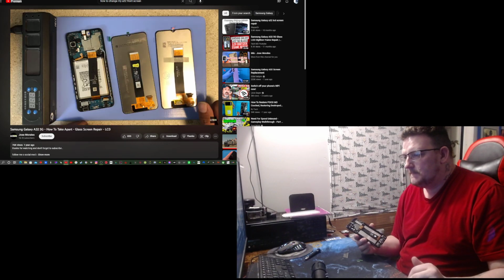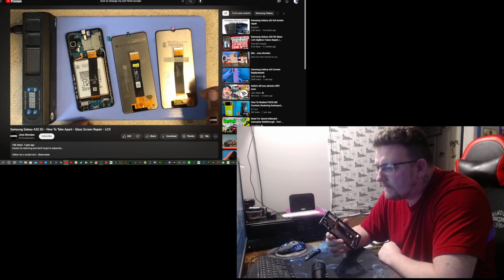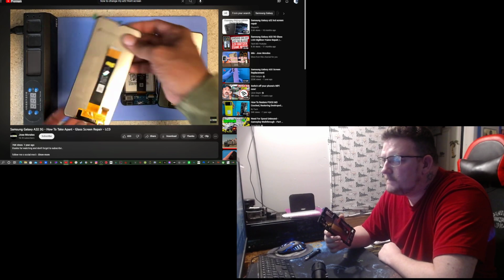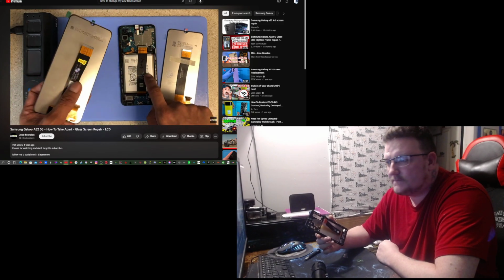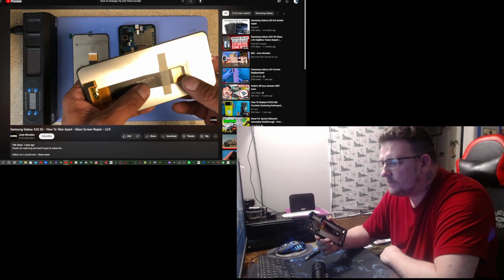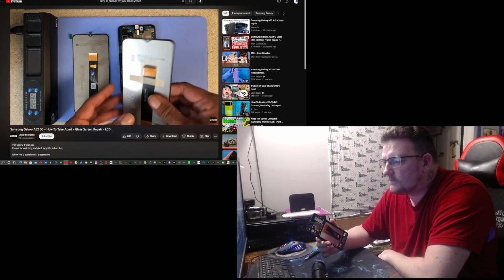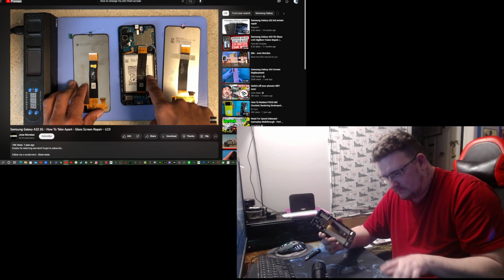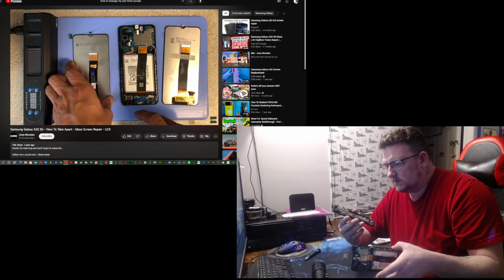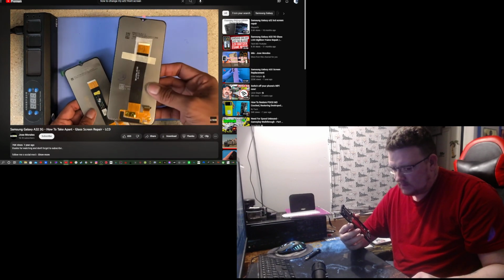All right, guys, this part of the video is being recorded 1 week after we start this video. And here's the reason why. Because the part I ordered was the wrong part. It was made for the international version of this phone, which I had to order. Now I ordered the US version model LCD for this phone. If I connect this LCD onto this one, it will not turn on. You will not see any image on the phone. So I had to stop and order the right one.